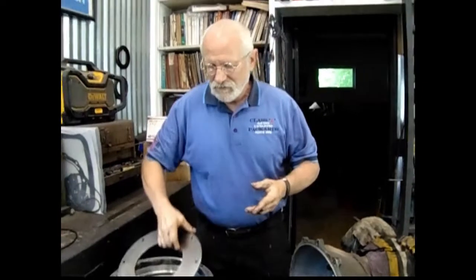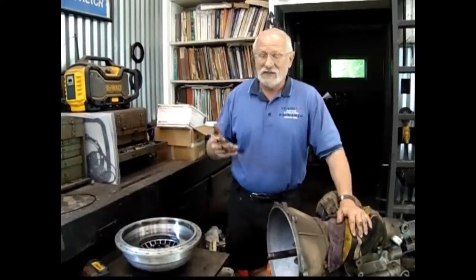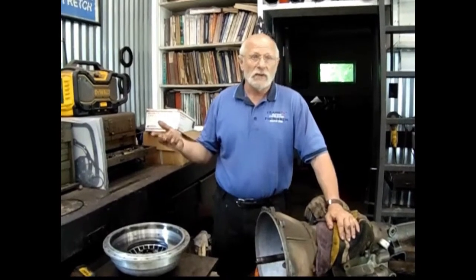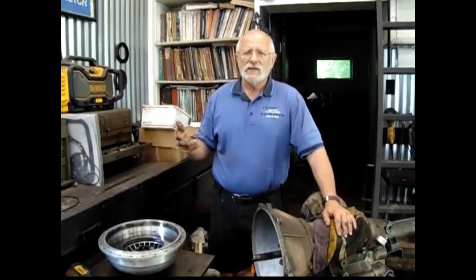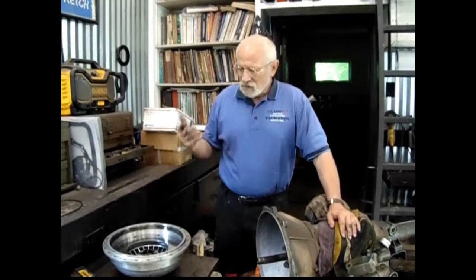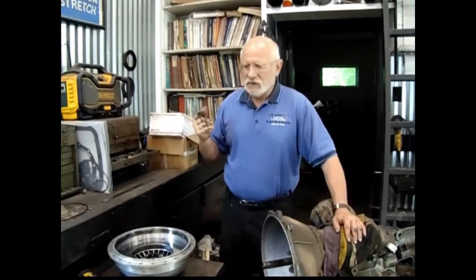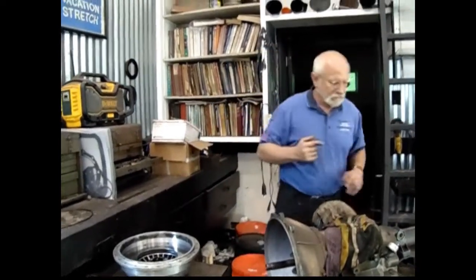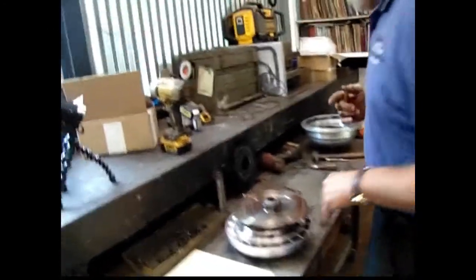What symptoms are there when you know that's happening? The symptoms you'll get will be the same old symptoms — the clutch will groan. It won't hold going up a hill; if you're going up a hill, it'll try and shift into direct and just slip. Because even on a fairly heavy car, if the direct drive clutch is right, it should snap right into direct. And an awful lot of them don't.